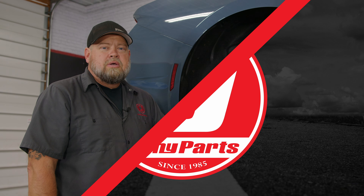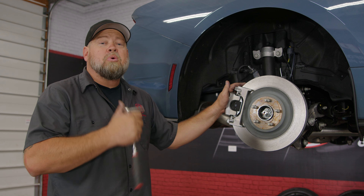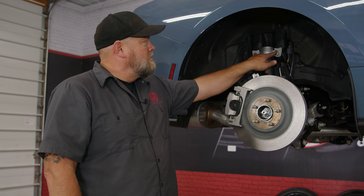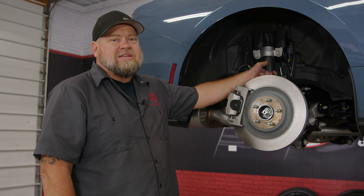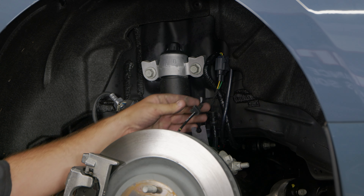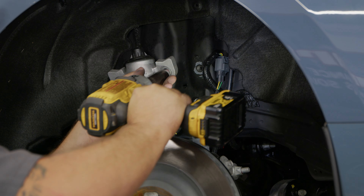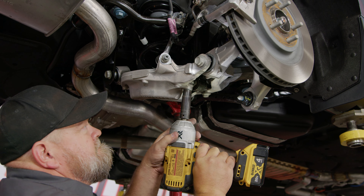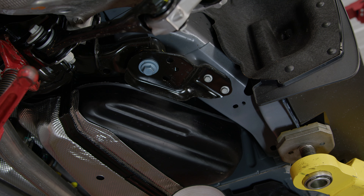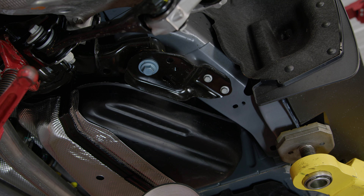Moving on to the rears — these are not quite as involved as the fronts. Basically what we have to do is lower the subframe down, so make sure you have a way to do that. First thing is remove the brake caliper hose bracket, the upper mounts for the shock, and the ABS line. Pop that out, and then those bolts are next. To remove the shock, take out the two bolts down here. To remove the rear spring we have to lower the subframe — start with the two front bolts for the bracket, then remove it. Before you do this, make sure you support the subframe with a jack.